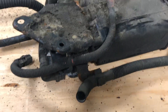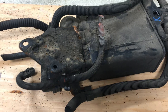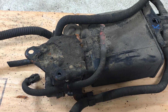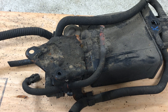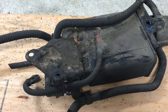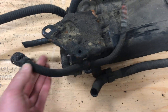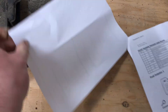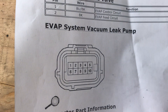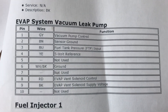In doing this I was frustrated because there's very little information about this car with such a simple code. I had a hard time finding information so I thought I'd post this to help someone. If you have a 2005 to 2008 Toyota Matrix or Pontiac Vibe with P0451 or P0452, at least now you'll know how to troubleshoot it — you're dealing with that connector. There's the pin layout and what each pin means. Hope this helps.